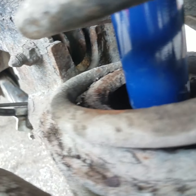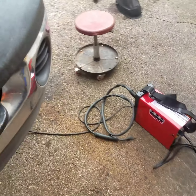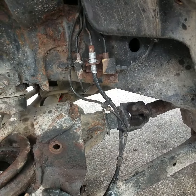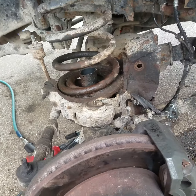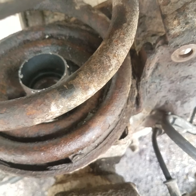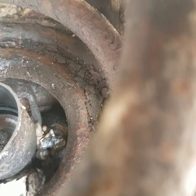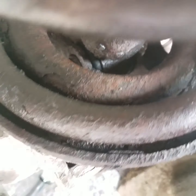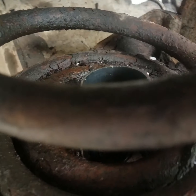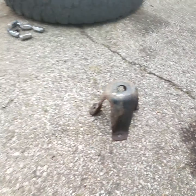On the other side — the passenger side is all done, I'm doing the driver's side now. This one the shock was completely busted because one of the A-frame arms that hold the axle in place was bad, so we had to take it all apart. But you can cut the shock out of the way if it's already leaking, tack weld the slug right onto the bracket assembly, then go in from the front side to the bolt on the front of the axle bracket, undo that bolt, and pull it right out. On the driver's side you also need to undo the coil assembly right there.